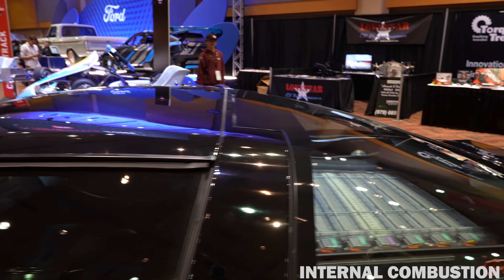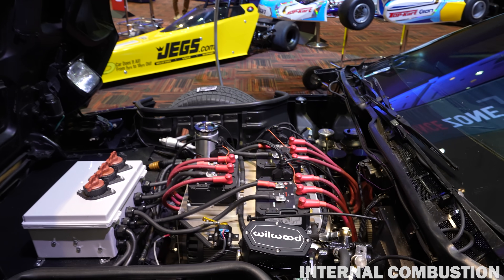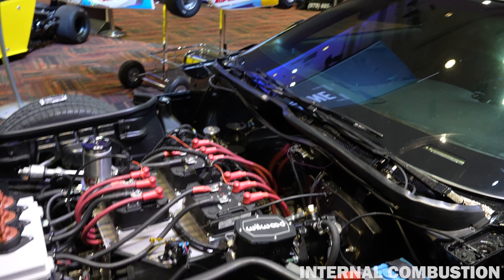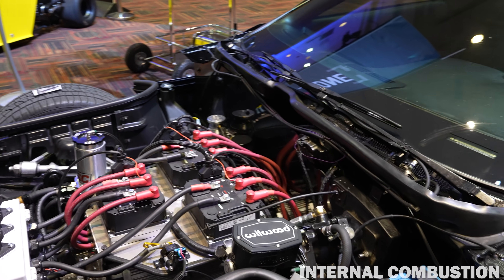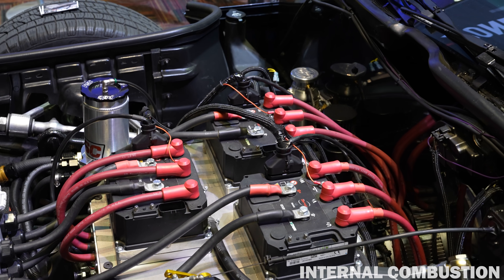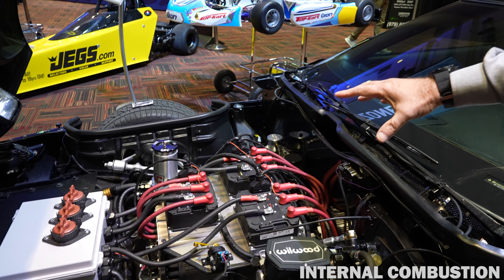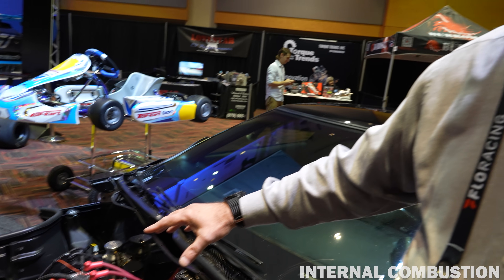Let's take a look at the motor again. So it's three motors connected together — the input shafts are all connected, like Legos. And then up top there we have the three motor controllers. They're DC to AC controllers, actually receiving 170 volts, and then they send three-phase 100 volts to each of the motors.